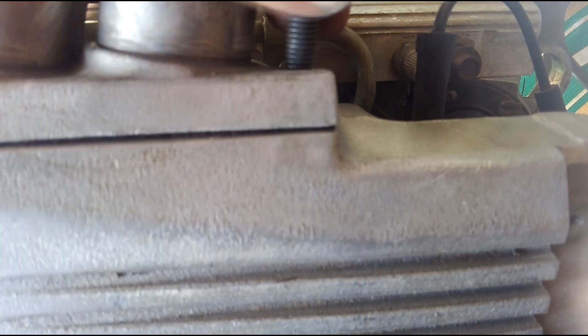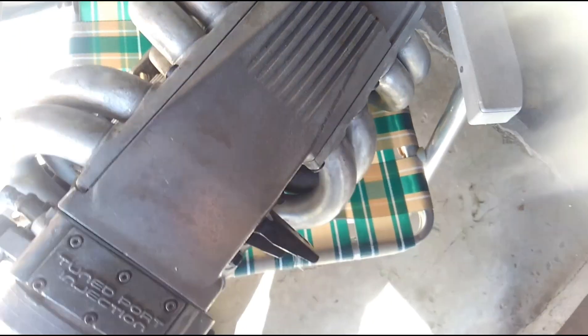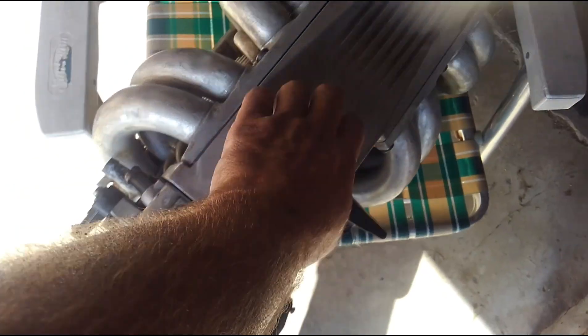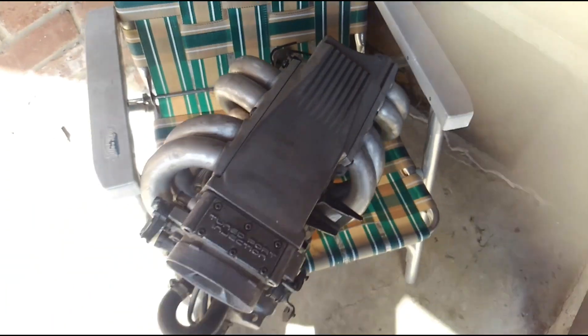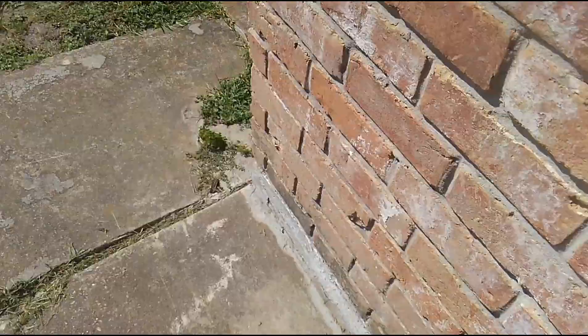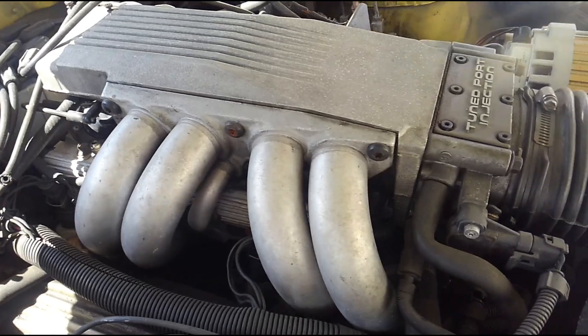Getting this apart is a bit of a struggle. These bolts are not very long, and what you need to make sure of is that this is a T40 Torx. You can see how this one's kind of worn out — it's been off several times. What happens is when you try to get these out they become stripped and they're worthless, so that one we obviously won't use anymore. What we'll end up doing in the next video is pulling the center plenum off, then we'll start with the runners and move on to the lower intake and distributor.